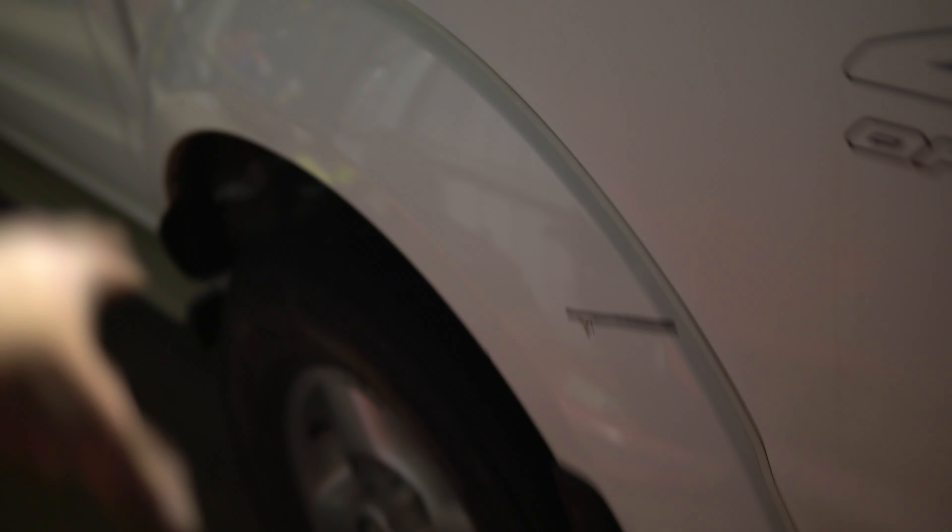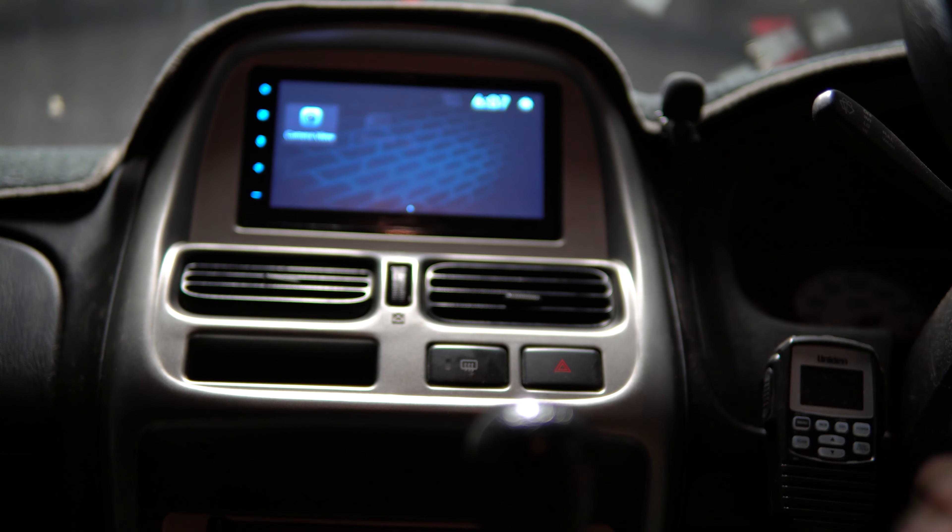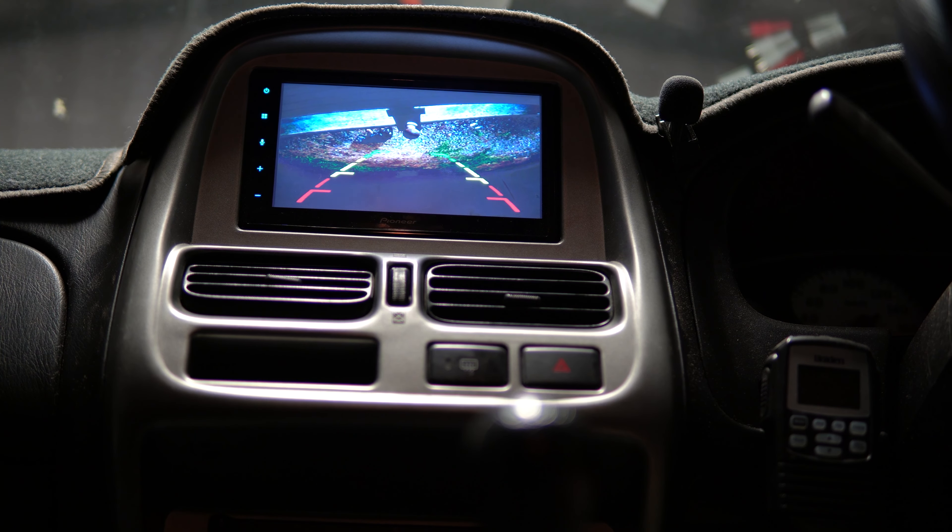The wires are now dripping down underneath — I'll start routing them underneath the cab to the back. I'm under the car now — probably could jack it up for more space but I'll manage. The red wires are dropping down so I'll trace along using zip ties, keeping the wires away from any moving parts and anything hot. I've gone ahead and traced all the wiring under the underbody of the tray and also mounted the camera — it was getting dark so I just pushed on and got it done.